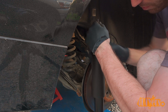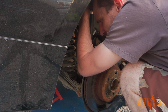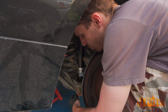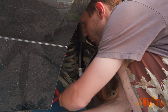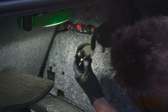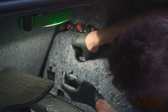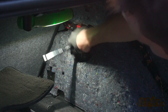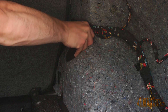Back on the car, compress the shock and insert it into the bottom portion first with the bushing onto the control arm. Make sure the top portion is inserted into the hole, then insert the two bolts. I cleaned the bolts with a wire brush and applied medium-grade thread locker. The torque specification for these bolts is 44.2 foot-pounds or 60 newton meters. I raised the control arm with a jack slightly to help push the top of the shock into place so I could fully thread on the nut with the bushing — lubricant was applied to the mounting faces and center hole. Torque for an M10 top nut is 19.9 foot-pounds or 27Nm; for an M14, it's 27.2 foot-pounds or 37Nm.